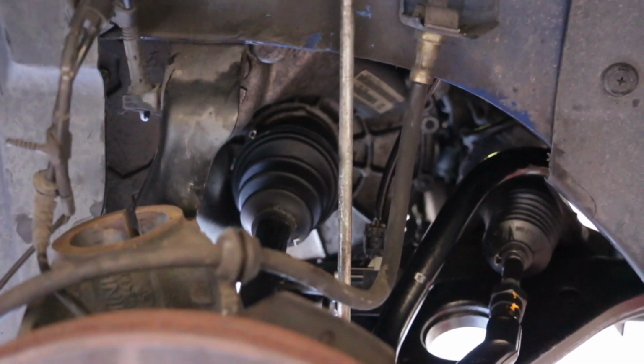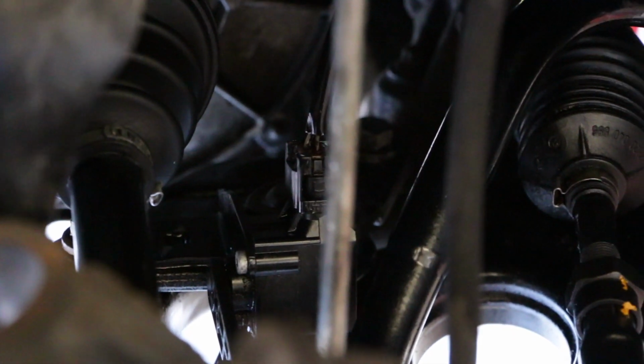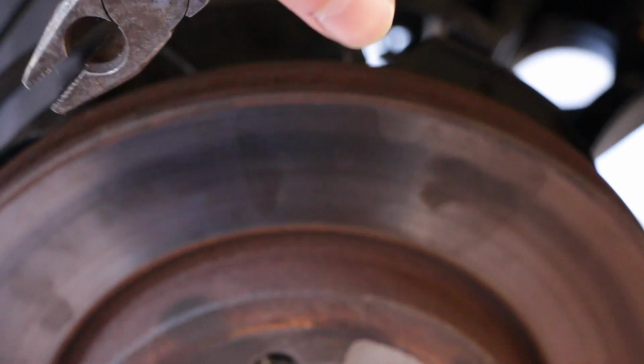The only tips I could give if you've had that problem on your driver's side: first take a look at the level sensor, the headlight level sensor, which is that black box right there. That was initially bumping into the boot, and although all of the arms and things looked like they were in good condition, the bracket that attaches to that metal beam right there was bent. So I just grabbed this tool right here, really easy. I bent it back, so now there's enough clearance between that and the boot. Shouldn't be a problem in the future.